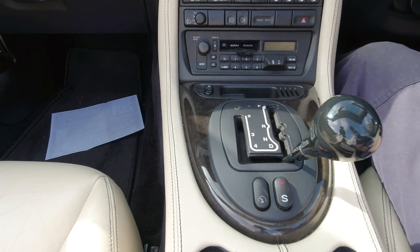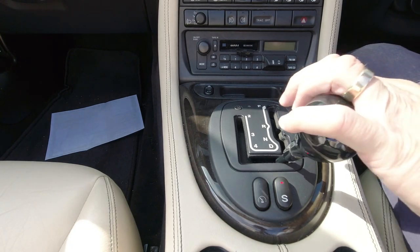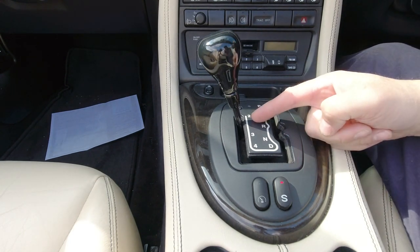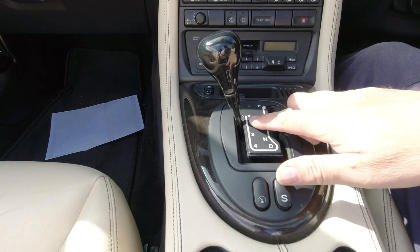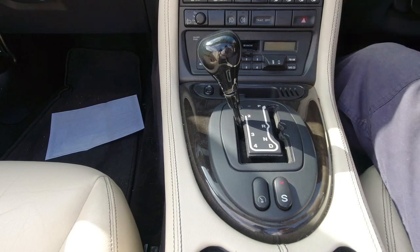Or, because we're humans, what we're able to do is go, I'm going into this bend, I'm hitting the brakes, I'm gonna want second on the way out. And the car will change into second. The revs will rise because you're decelerating. And as you hit the point where you want to accelerate, you touch the gas and you go, and it's instantaneous. If you've got a normally aspirated 4-litre V8, that's all about torque and responsiveness.